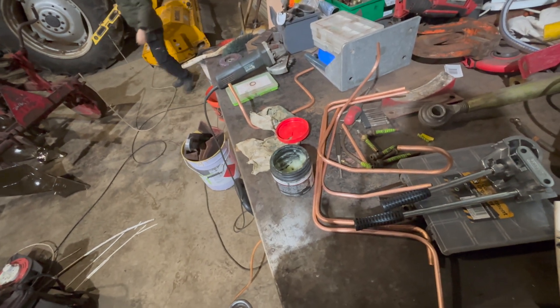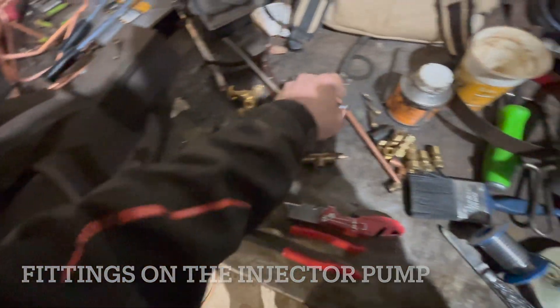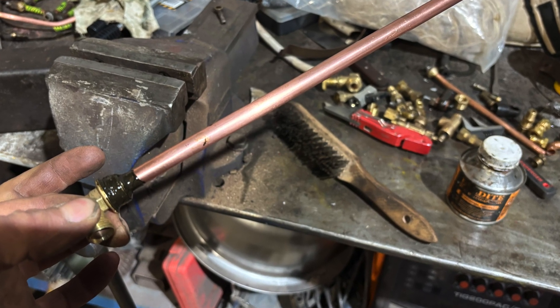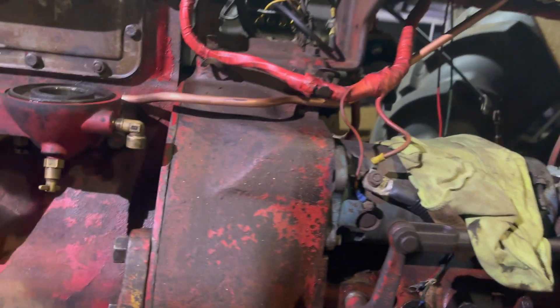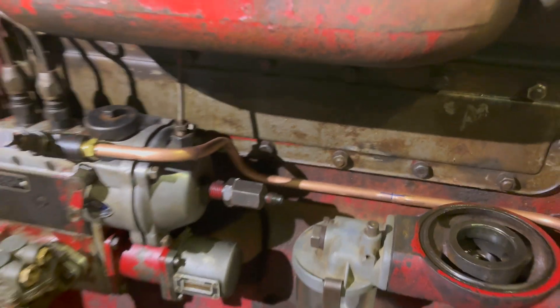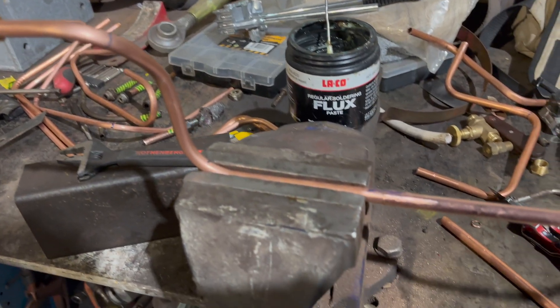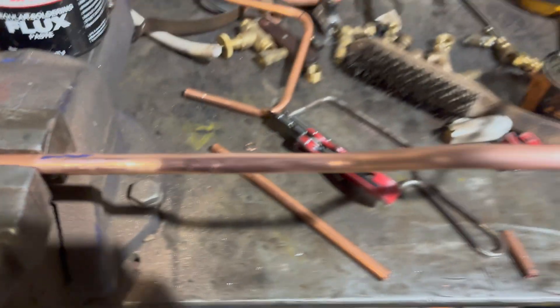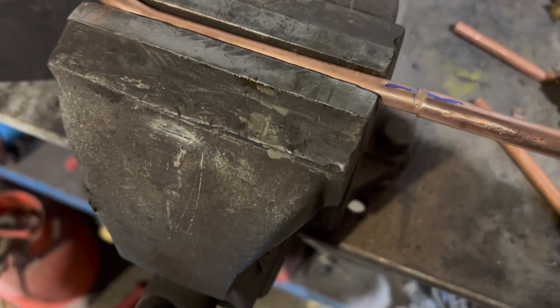I've been to Rydale Brakes and took them some templates and bent some imperial — I think it's 3/8 and 5/16 pipe. I've got a mixture of fittings and stuff. Here you can see I've used traditional hemp and black Heldite oil seal to make a connection onto the oil tank, and then bent that pretty much all in one pipe. One's 10mm copper and the other's imperial. The return from the injection pump back to the tank is the breather stand pipe. I've put a blue line on there to line it up so when I put it in the vice to solder it I know it's right, using steel wool to clean it up and flux to make sure the solder will stick.